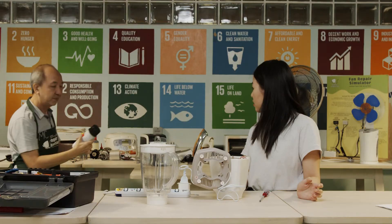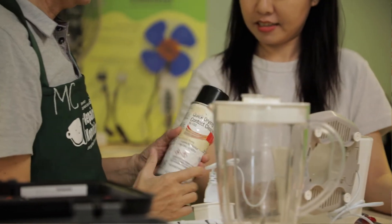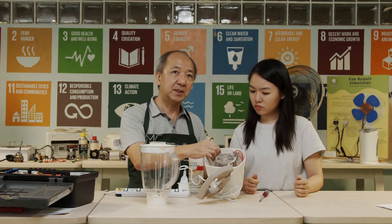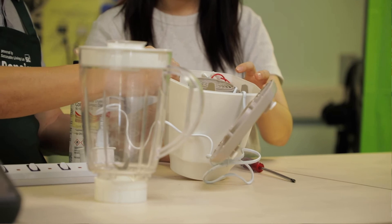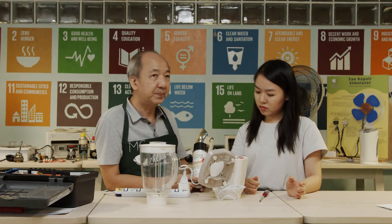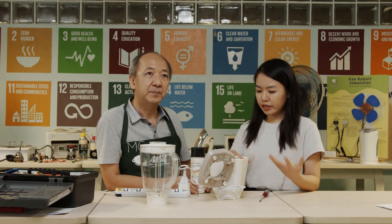Can the blender fail because of the selector switch? Good that you mentioned this — the selector switch often fails because food or liquid gets into the switch and contaminates the mechanical parts of the selector. As a result, it gets stuck or loses contact. Using contact cleaner, you can clean it up. Selectors are usually harder to replace as they are designed for a particular motor of the machine, but cleaning the contacts with contact cleaner usually works.